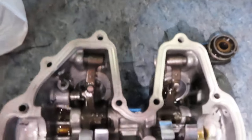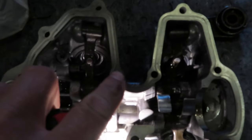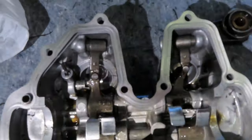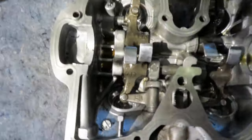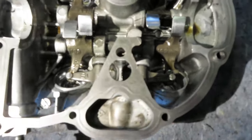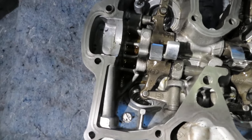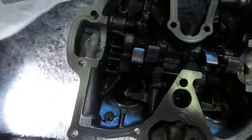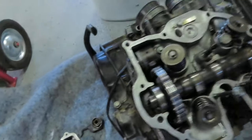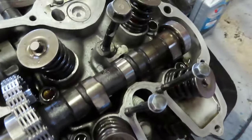This is a really cool gasket that has a ridge in the center of it to help it seal. I'm going to put a really light layer of RTV on here to make sure I don't have any oil leaks. I don't know if that's necessary but that's what I'm going to do — that's how I had it before and I didn't have any issues with it.